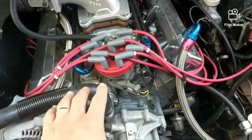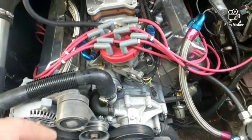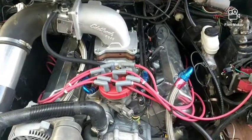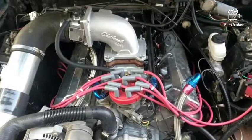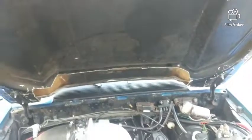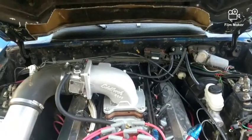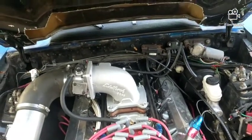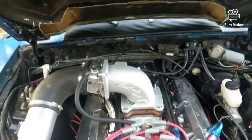What I'm going to do is take this Victor Jr off and mount the engine coolant sensor up here. I've got an aluminum disc I'm going to have welded in, tap it, and put the sensor up there for whenever I use this again — most likely on the red car, I've got something percolating. I think I'll stick with a Holley lower on this and a different upper I was originally going to use on the Capri, but we had hood clearance issues. The Systemax upper I'm using I actually butchered several years ago when I had it on the LTD — I cut about three and a half inches of runner length out of it, which made more power at peak but I lost some mid-range torque.